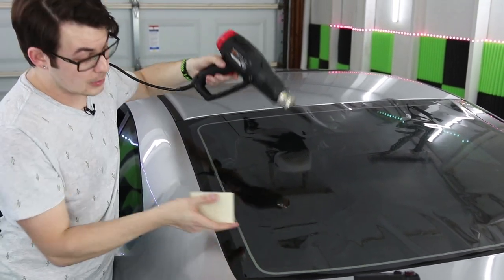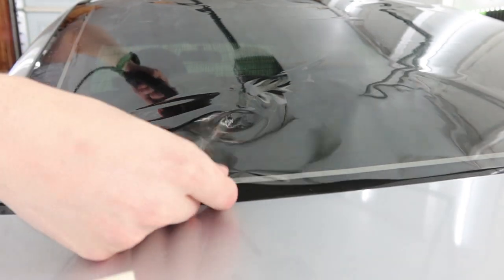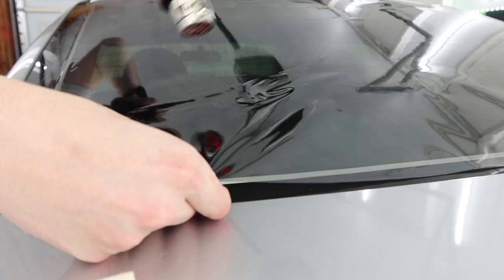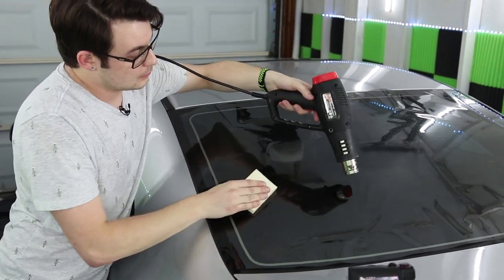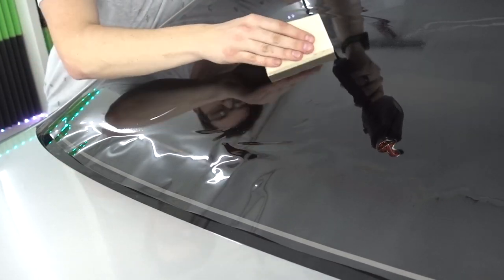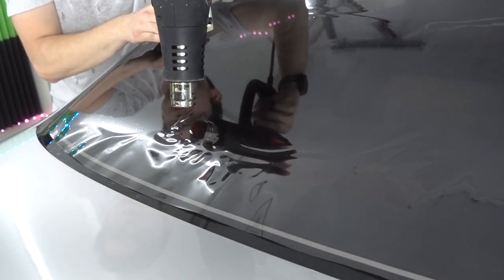And then as it starts to bunch up, I'll start to do a couple of things. You can pinch the bottom and hold it, and then take your heat gun and evenly shrink the whole thing, and then come back over here and bring this down too. And stop in the middle point because we're gonna shrink it in sections, like quarters.